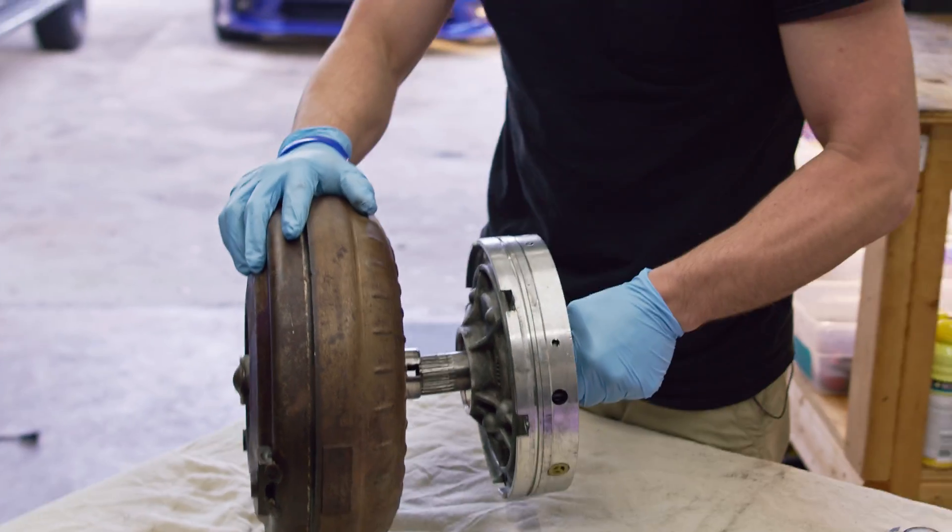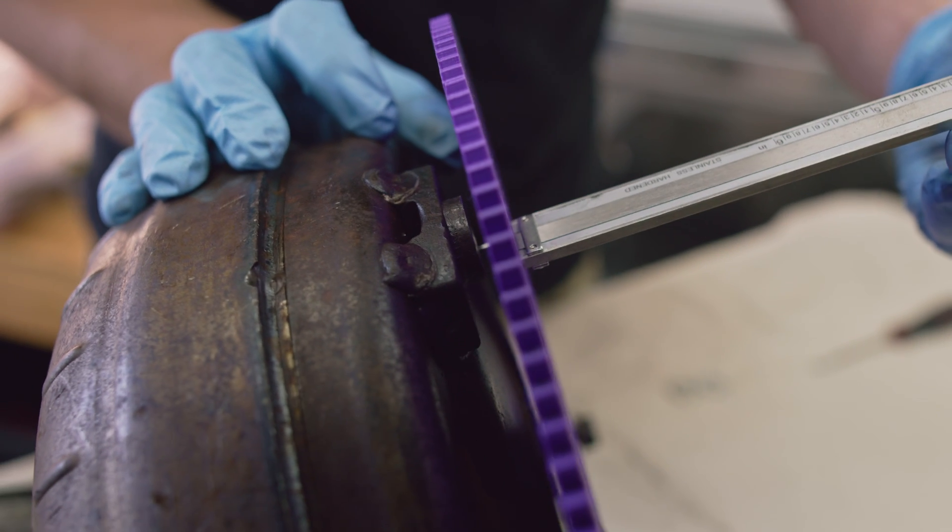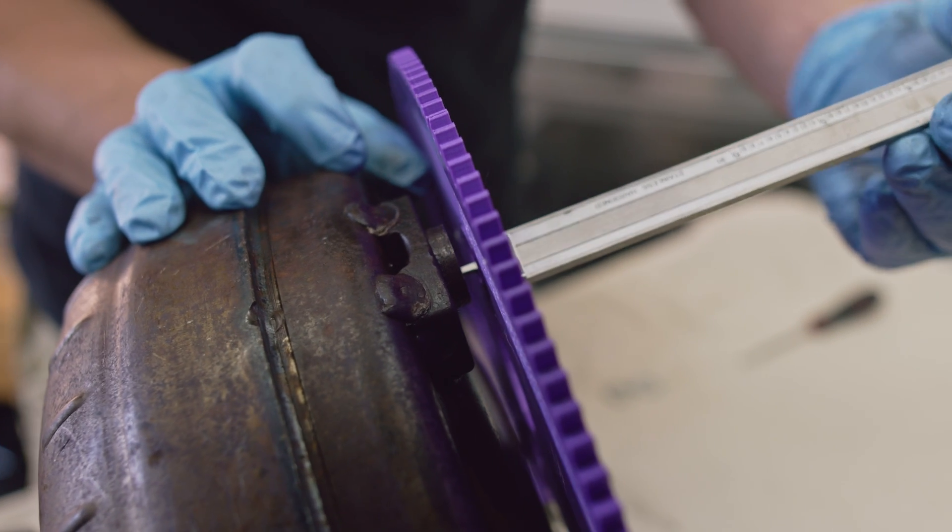Here you can see how the pump and torque converter fit together. To demonstrate how we measured the gap between the torque converter and flex plate, we bolted the bell housing of the transmission to the block and used a caliper to measure the gap between the two. Our gap was 339 thousandths of an inch, which means we needed to shim the flex plate to between 153 thousandths and 214 thousandths of an inch to be within operating tolerances.